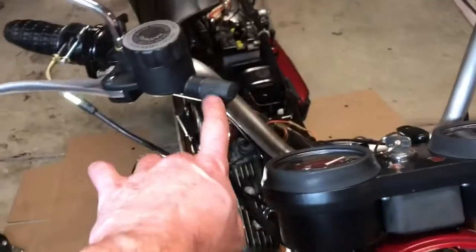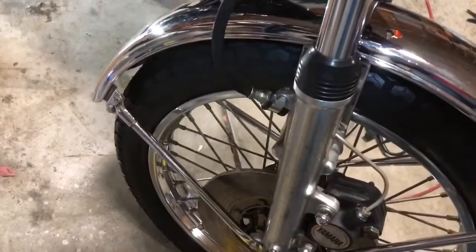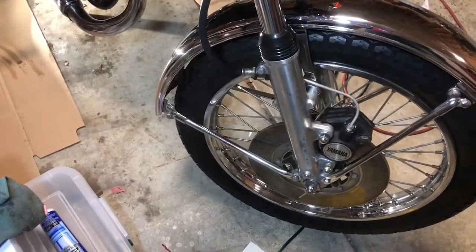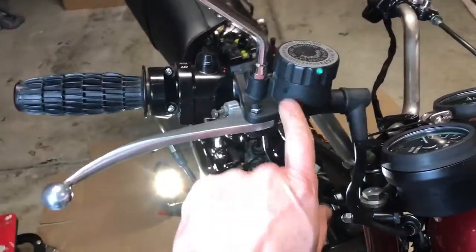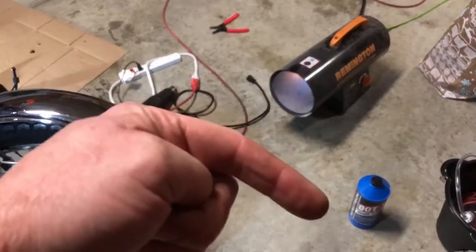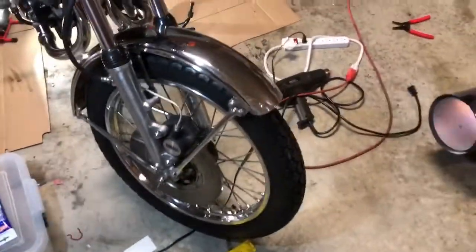It did have a leak — I went through and tightened all my connections. There was a leak right over here, so I took it off and tightened it down just another quarter to half turn, and then it sealed up. Got nice brakes and they feel really good. Don't let your reservoir run out while doing it — keep pouring more in. Pull that bottle up about a third of the way so the tube stays underneath the fluid; that way if air comes out it bubbles up.